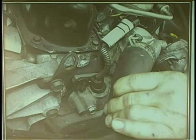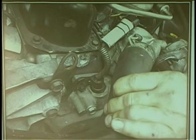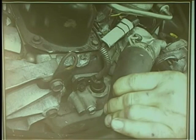Especially if you're putting a sensor on a spindle where it's going to measure the rotation of the axle trigger wheel. Make sure it sits flush. If there's any rust in there, don't clamp down on a bolt and have it on an angle like this. You have to have a 1/16 of an inch, that's all you need. 1/16 of an inch can have an effect on the output of that sensor. I kid you not. 1/16 of an inch.